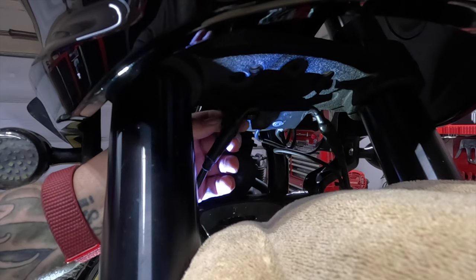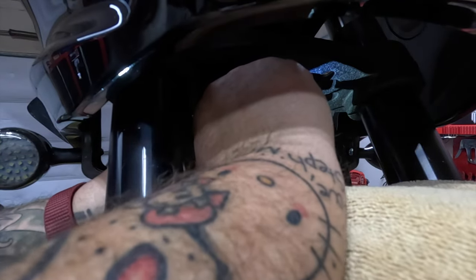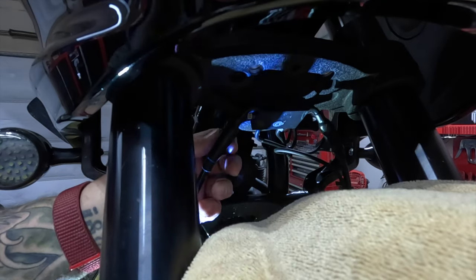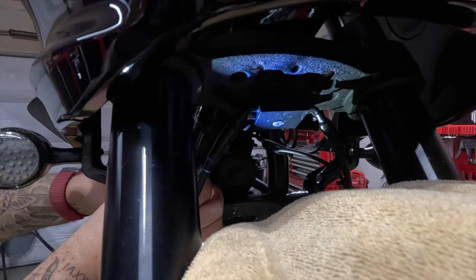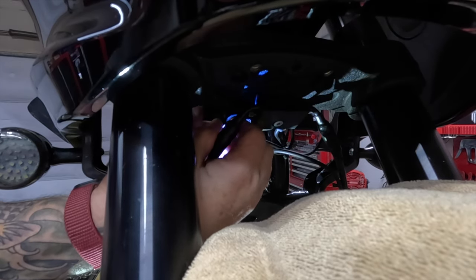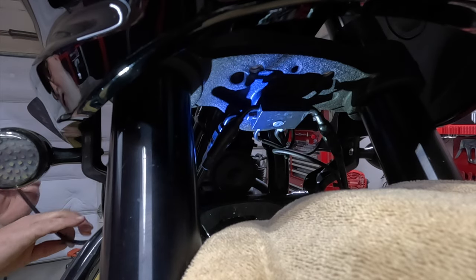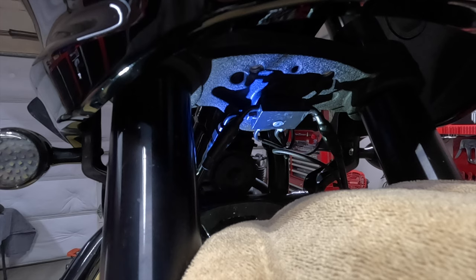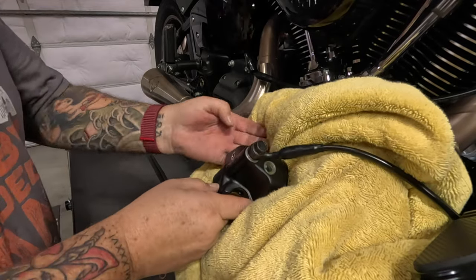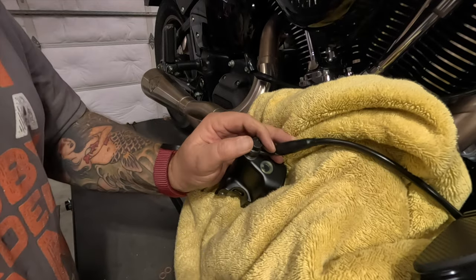We took the 90-degree angle off of the cable and got it started up here — takes a little finagling. Kind of grab it like so to get it where you want it to go. Just snug it down finger tight and still allow that movement. Then take the new cable, run it up here, and connect it to the end — just finger tight, make sure you don't cross-thread it. Now this is loose so you can move it around as you route it. Then move over to the master cylinder side and get that connected. That sucker was really on there — I had to take it to my vise and pad it up real good to break loose on this 14-millimeter.